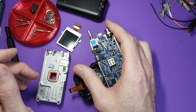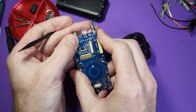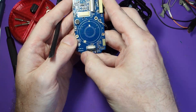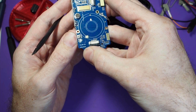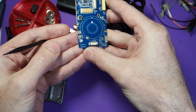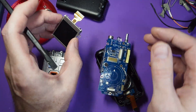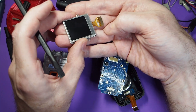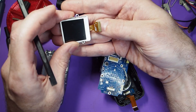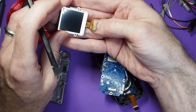There are a couple of interesting markings on the board. The board fabrication date appears to be work week 26 of 2025, which fits as being late this year. The marking on the board itself is '5R Mini 1.6,' dated 2025-06-09 — so just taped out or fabricated in June of this year. The display has a flex cable with 24 pins on the flex connector. Not specifically familiar with that connector layout, but some folks might know it already.